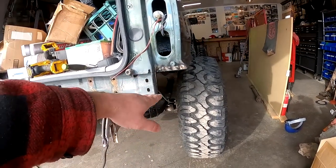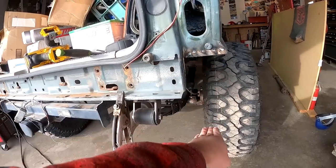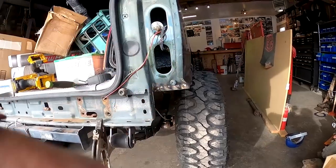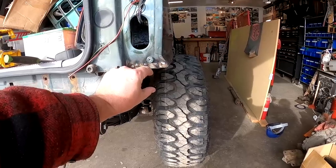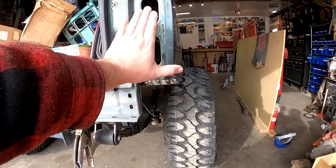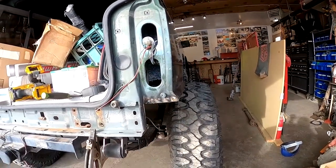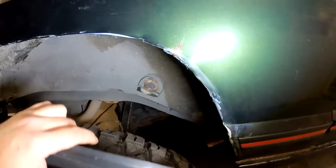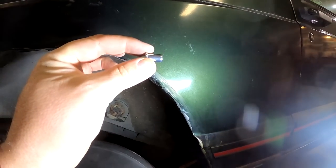I cut this section out, cut the back piece out low, and then we can just fold this part up — which will create a nice welding point when we fold this side up. If you've had one of these that's all rusted up, you can just cut it straight off and get a piece of plate cut to fit in here and weld it in, but I like to use what I already have because it's free. It's tacked on — you can see how far that sits down below here. We just gained an astronomical amount of departure angle coming off the tire going up. I'll still have to build a bumper that fits under here — probably about an inch-and-a-half to two inches — to make sure it's structurally strong and going to protect the tail light. I drilled it out and put these little nut-certs in there.